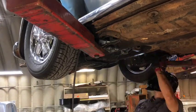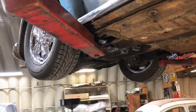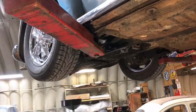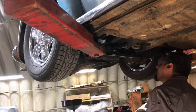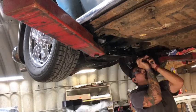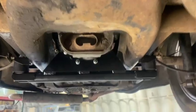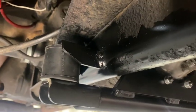Once they're welded in, they will pull down a little bit, and that's as per the Berg instructions, so that it'll also tighten it up when you remount it. You'll want to make sure to paint all the bare metal with decent paint so that it won't start to rust. So that's it. I got her burned in, and then I put a little bit of paint on it. Obviously you don't want things to rust after you get done.